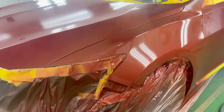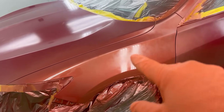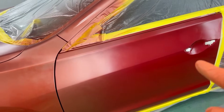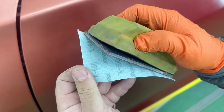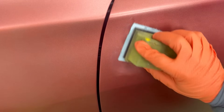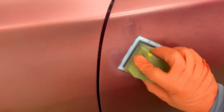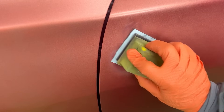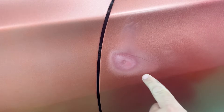I missed a little dent right in this area. If it were further away I'd leave it, but I'm going to fix it real quick. What I have here is a Kovacs block, a hard interface pad, and K600. Make sure it's completely dry. You're not supposed to sand in a booth, but what's your alternative? Just give it a little scuff. The UV stuff is really changing the game. I'm scuffing enough so I'm putting the UV on the clear coat finish rather than base coat, that way I get the adhesion I need to a solid finish. I'll put a little bit on, cure it, then block it.